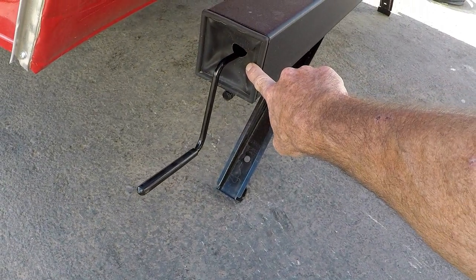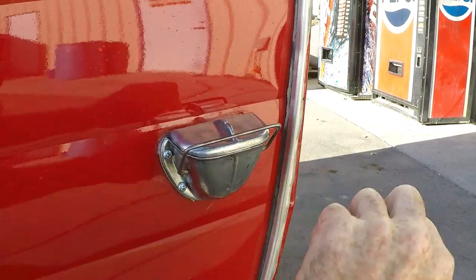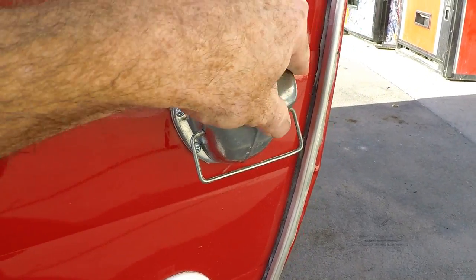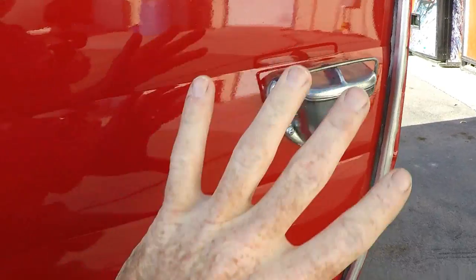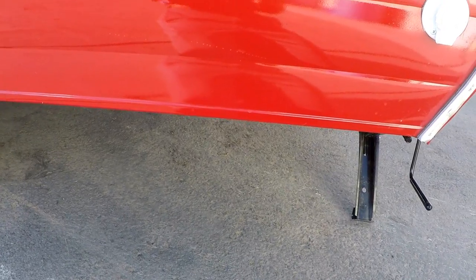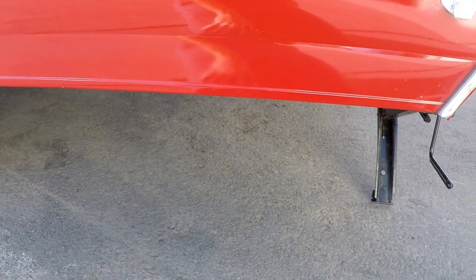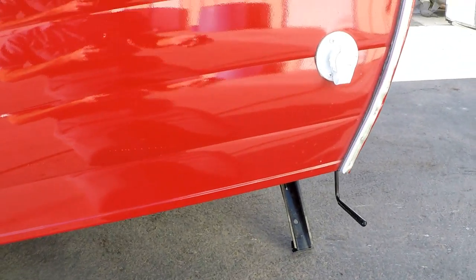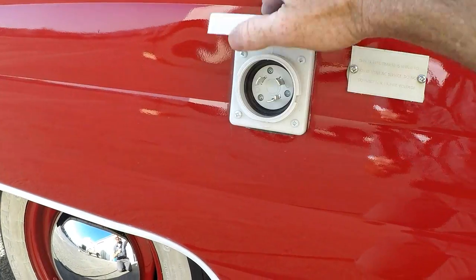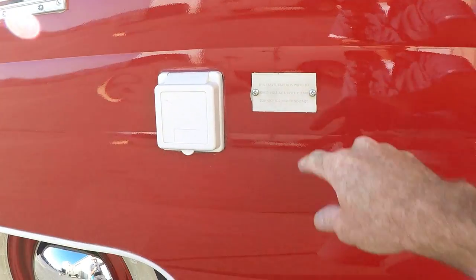This removable section is where you store the sewer hose. This is the original fresh water tank fill - kind of looks like an ashtray. I just cleaned it up and polished it a bit, but it still works. The fresh water tank is right about here. The framing underneath was in great shape - that's one of the reasons I picked this one up. I re-coated and undercoated the underside to protect it hopefully for another 50 years. City water connection is right here, and that's the 30-amp hookup where the shore cord connects.